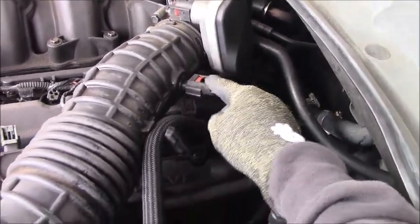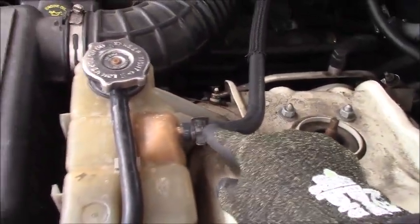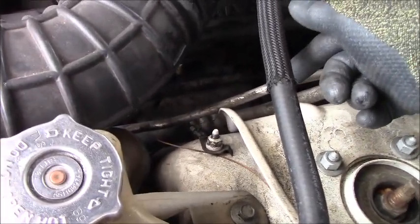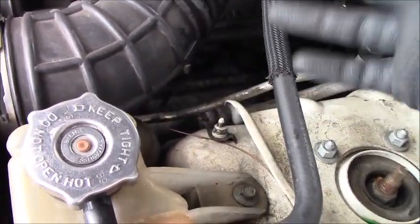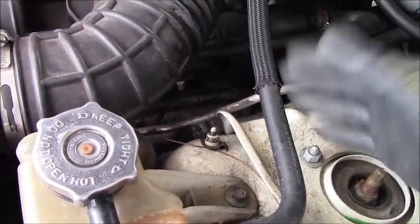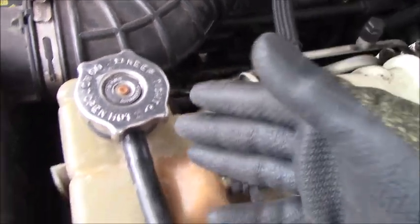I don't need to disconnect this. Pop something right here, disconnect the hose here, remove everything. And one more thing — at the bottom of the reservoir, we have to use a clamp or grip tool to pinch on the hose to avoid the coolant spilling when we remove the reservoir.